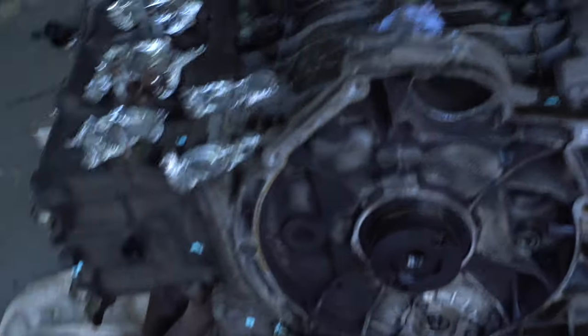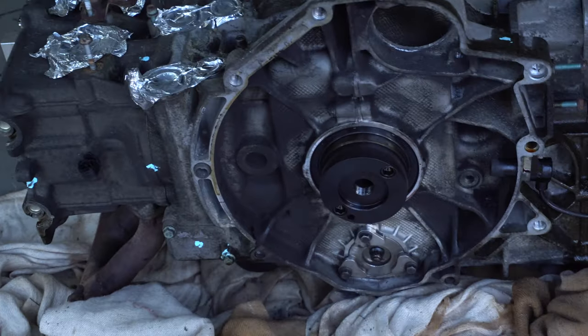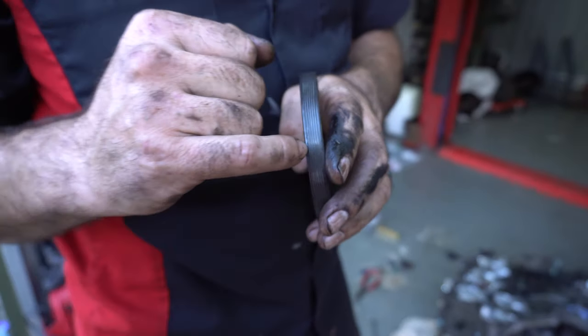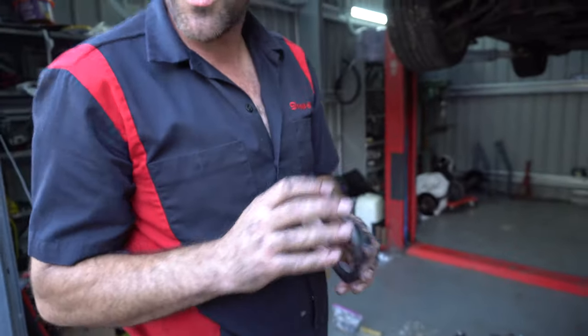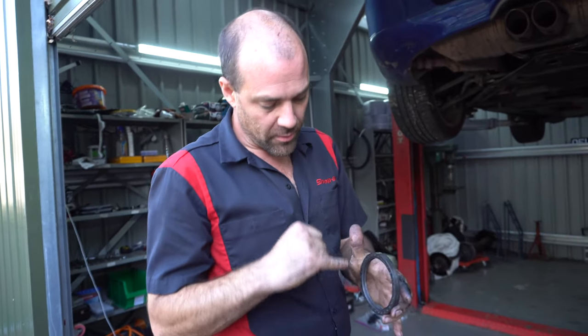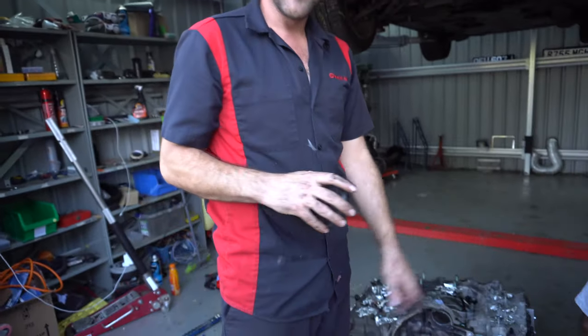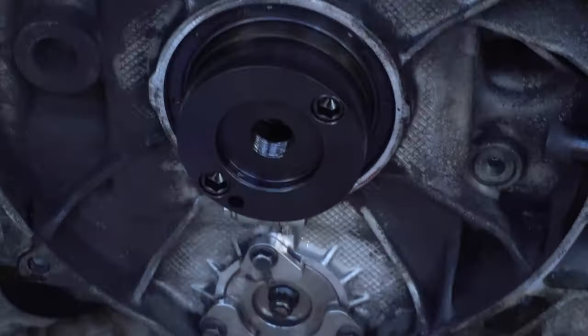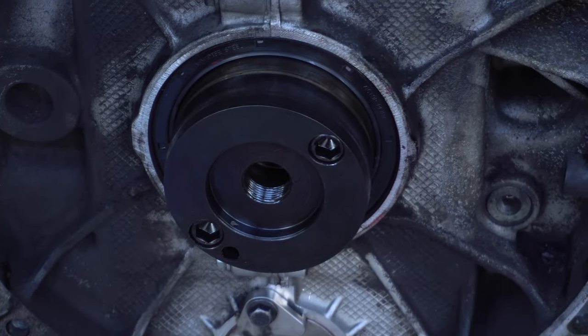The rear main seal is now set correct. Is that all done? Yep, that's it. Because that tool won't set it far enough in, I use the old one for a spacer. And the nice thing is, you can use these ribs to watch it walk in. Then you can follow the one rib all the way around to make sure it's flush. And if you look at it, it is flush. This is now trash. Correct. Excellent, mate. Very well done.